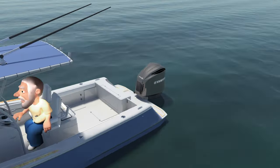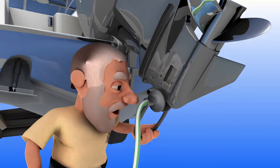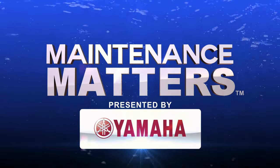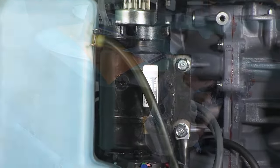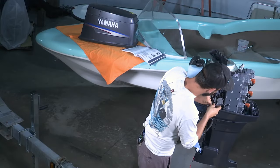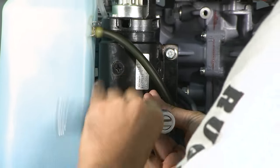From the start of your outboard until you return to the dock, make sure your boating experience is always fun and enjoyable by remembering that maintenance matters, presented by Yamaha. We're at this year's Fort Lauderdale boat show in the Yamaha booth with Rye Landry. Starters don't go out that often, but sometimes they do. Could you walk Brian back in the studio through how simple it is to replace a starter? It's a really simple procedure — disconnect the battery from the motor, disconnect the leads on the starter, then remove the bolts that hold the starter in place.